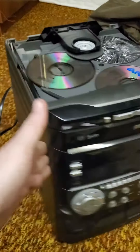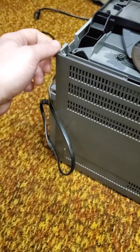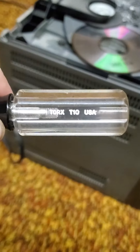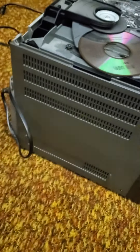So I took the top off. There's a screw right here, a screw back here, and one on each side — four total. The size I used was a Torx T10 screwdriver. You take those four out and then get in here.